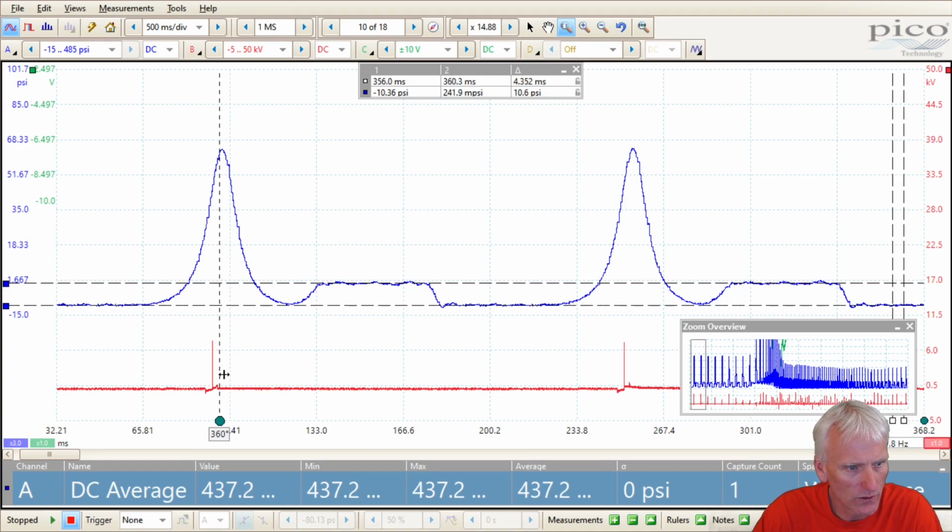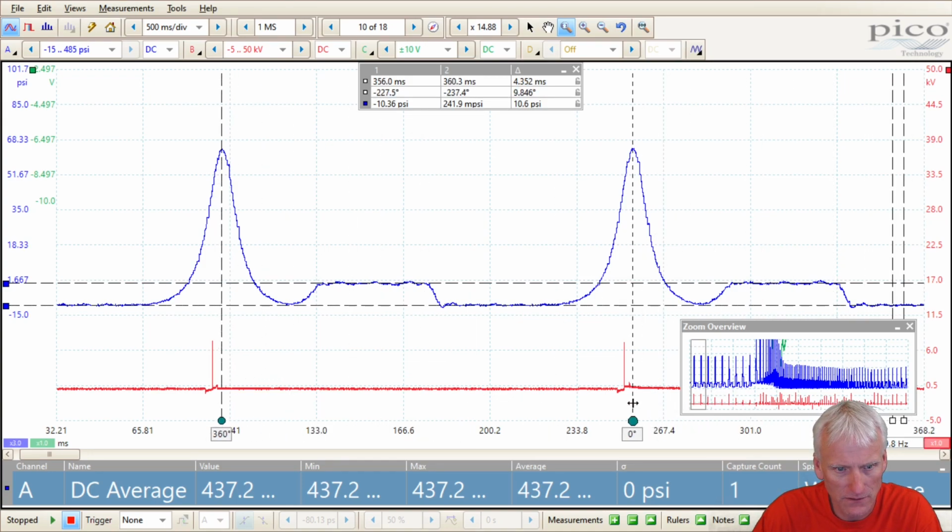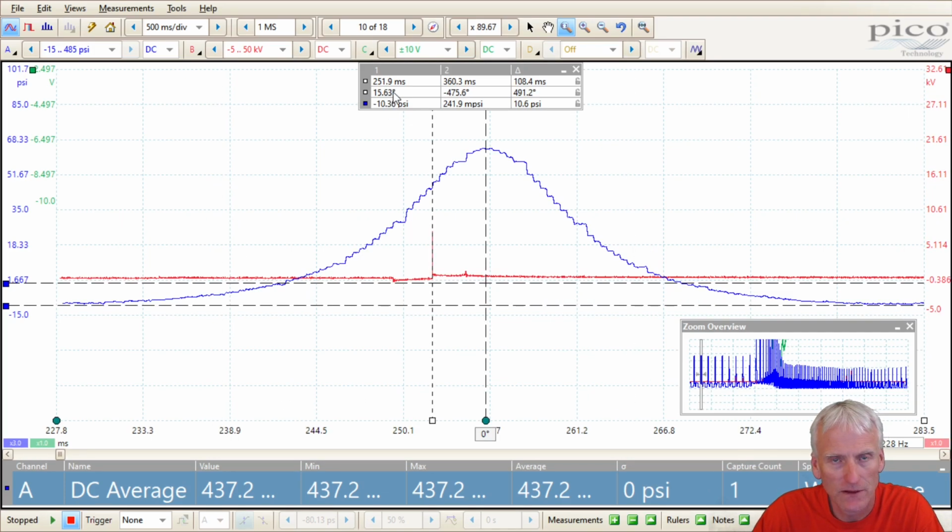And now it's time to check how well it does the compression curve and the ignition. So it's showing about 15.6 degrees, and if I bring it to the 8 or 9 that it's supposed to be operating at, you could see that it was about 1.4 milliseconds. So this series of sensor has about 1.5 milliseconds of delay, whether you're using the 300 or the 500 psi, and it spits out information about every 400 microseconds, or 0.4 of a millisecond. A little bit slower than the PV350, but it's not horrible.